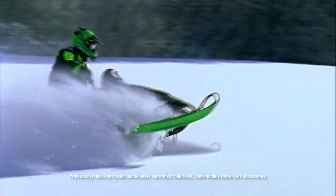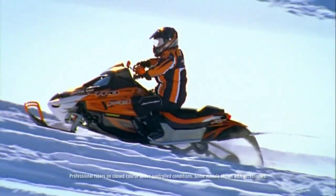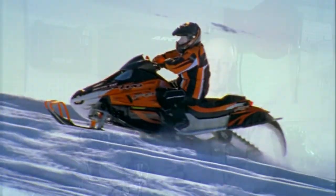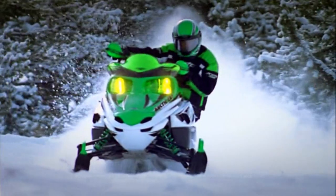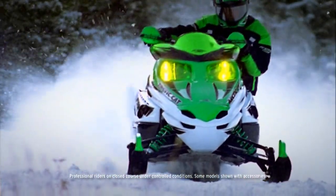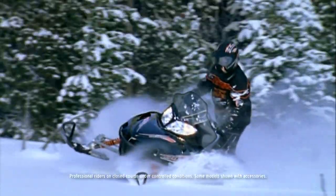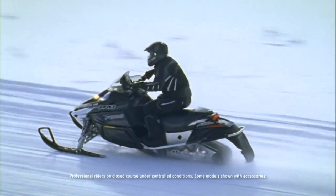Greg Spaulding, two-stroke engine development team leader, is glad to spend countless hours designing a new two-stroke. The EFI is on the 800 and 1000. We have so many more functions in there than we had even 2 years ago. We control not only EFI fuel timing, obviously, which we've done for a long time, but we control the operation of the exhaust valves, the fuel delivered, the ignition timing delivered, the acceleration function by fuel.